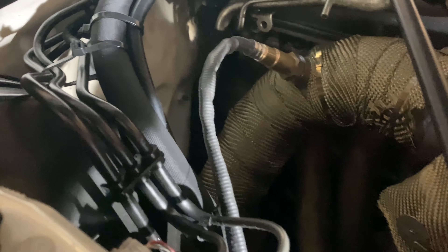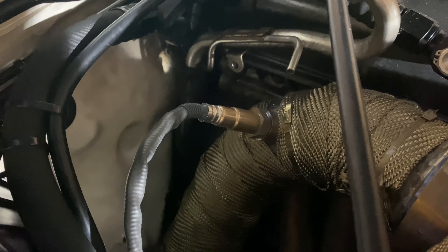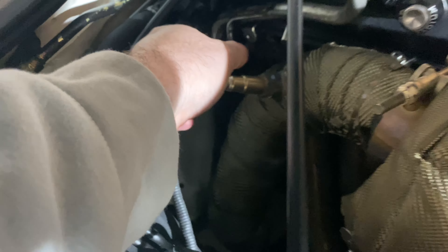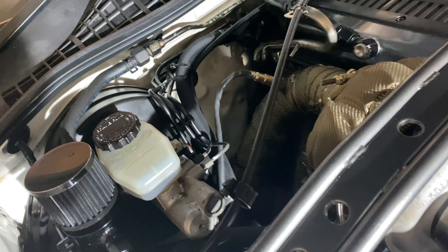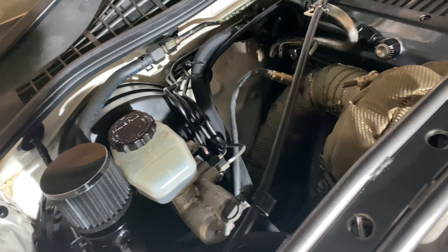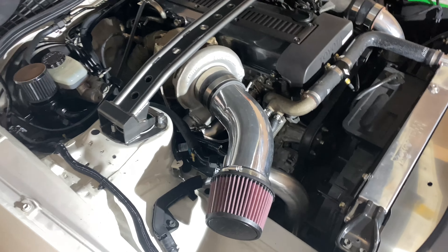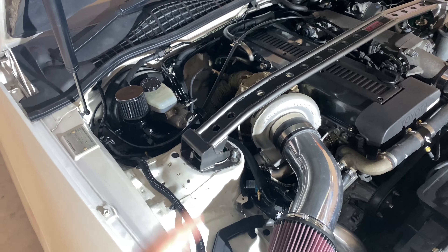So that's something I need to fix — I want to relocate the O2 bung somewhere else. This is where the O2 is now; I really didn't think it was going to be an issue. I'm thinking I need to put it more over here facing upward toward the firewall, maybe more on an angle but further down. And I need to decide what to do with the vacuum tee.